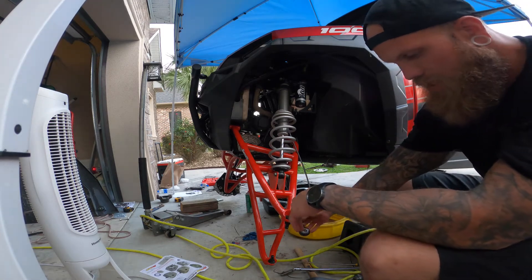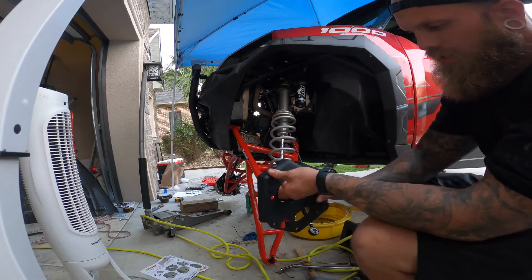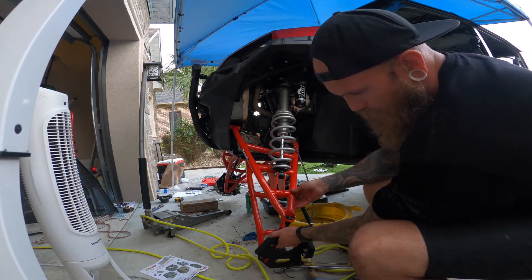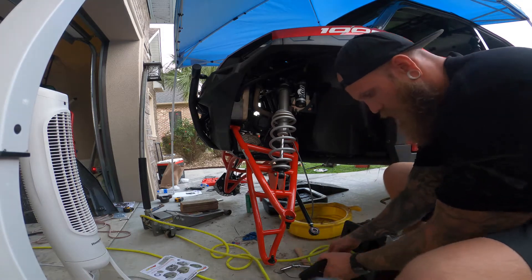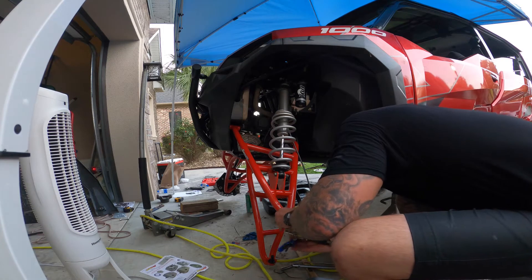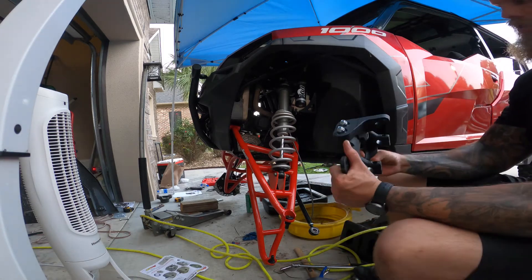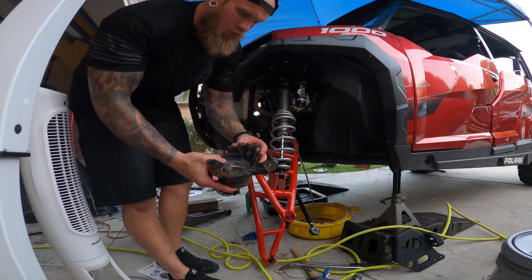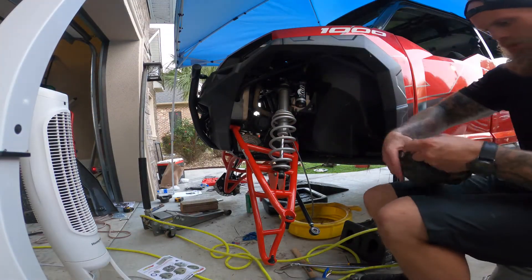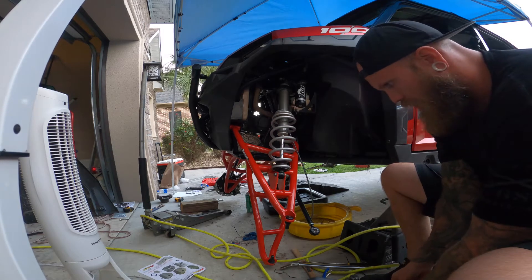I went ahead and put this tie rod — just remembered to turn my camera back on. I bolted these two pieces together, that's all I've done to this, and then this is going to slip on this ball joint. Now there's a little notch in your ball joints — you're going to want to spin that so that it catches that bolt. That bolt slips right through that little notch where this pinches it. You're going to have to take your stock bolts for the ball joints out of your carrier bearing right here. I'm really happy I saved all this stuff — it makes it a lot easier and takes the guesswork out of what hardware goes where.